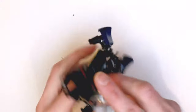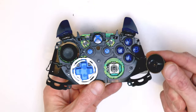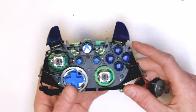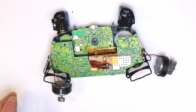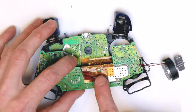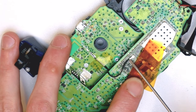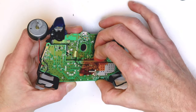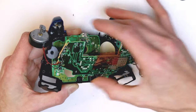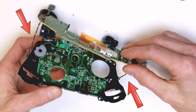You'll see that the joysticks are something you're going to want to remove first — I usually forget, and I did when making the video, but luckily the magic of editing sorted that. There is also one more thing to remember: there's a little connector here which is an antenna coax-type cable. Just put the flat-blade screwdriver underneath and twist it to disconnect. Be really careful at this stage — the wires are still attached and you don't want to snap them, as that'll make more work for yourself.